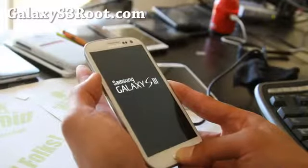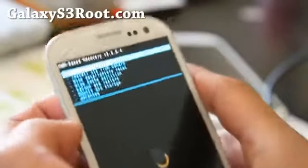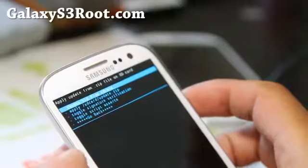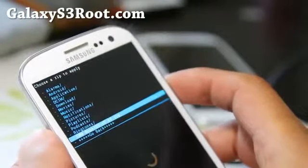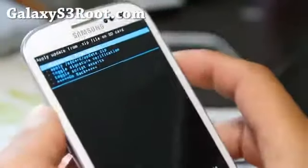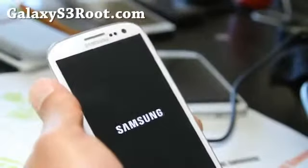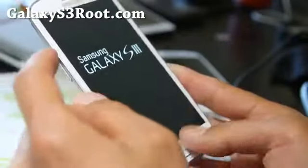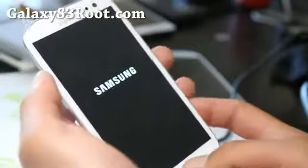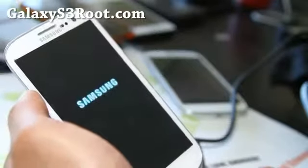I know a lot of you are having trouble doing this, so I just wanted to make this video to make it clear for T-Mobile Galaxy S3 users. Once you're here — let me turn on the lights so you can see better — go to install from SD card, choose from SD card, and choose that file you copied over earlier. Hit the power button, say yes, and that's it. Go back and reboot system now. Anytime you want to make a backup, that's how you do it: volume up, center button, and power, let go of power when your phone resets, and you'll enter ClockworkMod recovery where you can install, backup, restore ROMs, and also flash other zip files — such as the SuperSU zip file we just flashed, which gives you root.